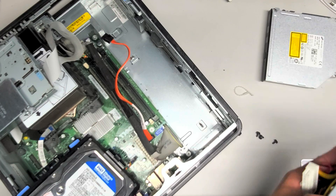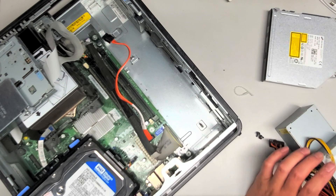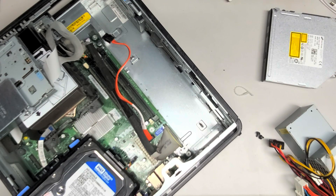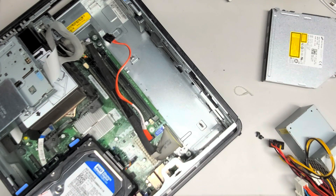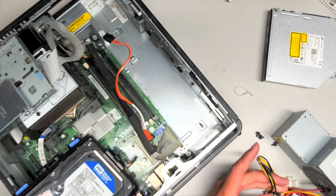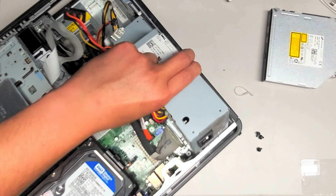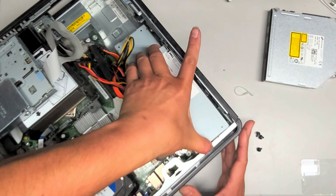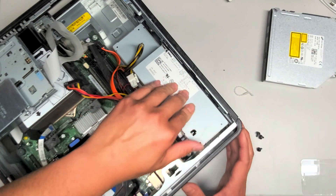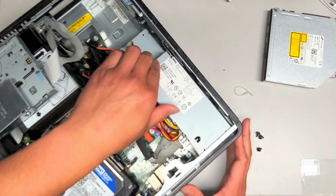We will get the replacement one. The replacement one is H275P-01. The model number on the original is L275E-01, and the replacement is H275P-01 — I don't know if it's more heavy duty or what. It seems to have the same connections, so we should be good. Let's go ahead and lift the new one in — make sure it's slid over to the left, get it lined back up, then slide it over to the right. Make sure if you try and lift this side up, it's locked into place.